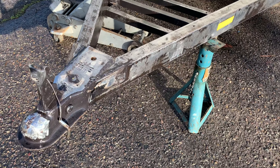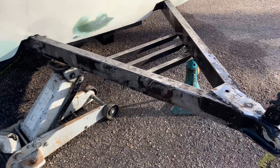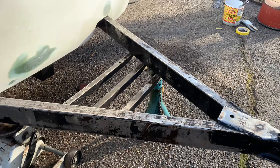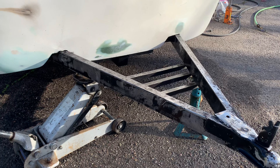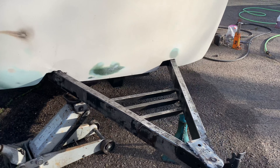Then I'm going to start applying the POR-15. I just wanted to show you because you want to make sure you paint and protect it - you want to get years and years out of this. The best thing you can do is sand all the paint down, put a nice coat of POR-15 self-leveling paint. It'll protect the metal for years.